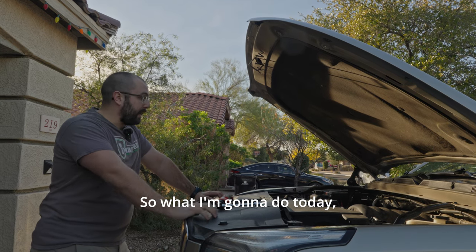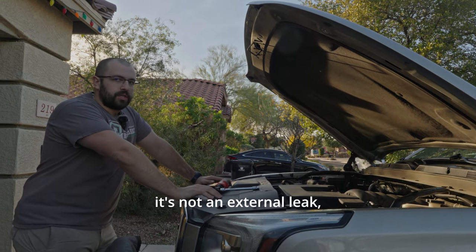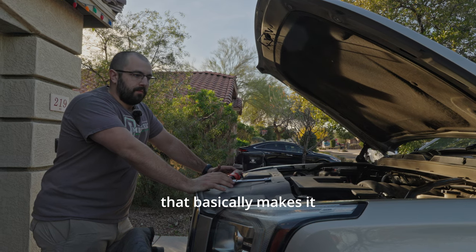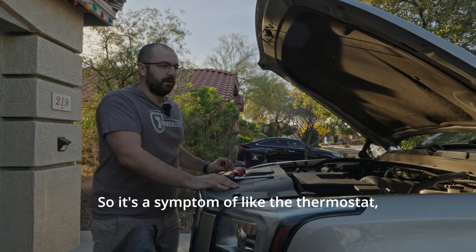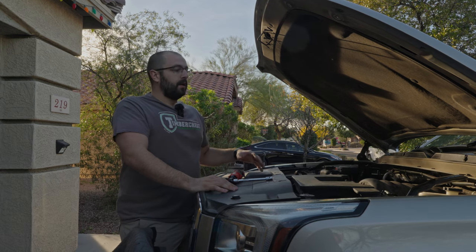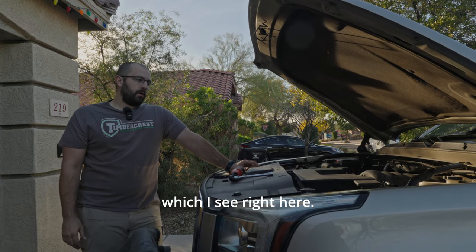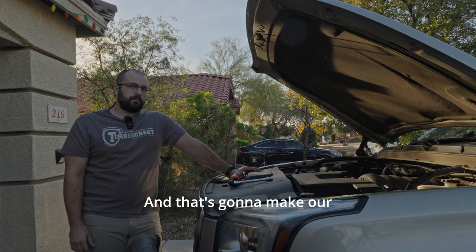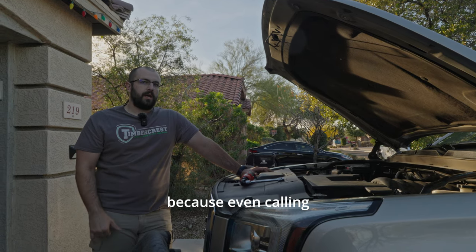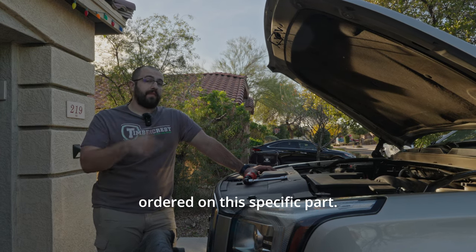What I'm going to do today is replace the whole thermostat housing. As far as I understand, it's not an external leak — it's an internal leak — and that makes it so the coolant temp sensor can't figure out what's going on. It's a symptom of the thermostat; maybe nothing will catastrophically overheat, but replacing the thermostat housing should fix our zero temp symptom. This seems to be a pretty common issue because even calling local GMC and Chevy dealerships, a lot of them are back ordered on this specific part.